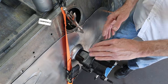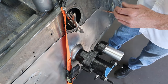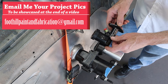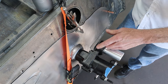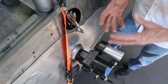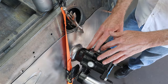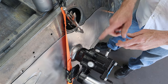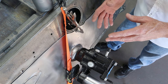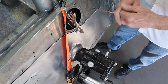I'd like to have it on this side so I have more valve cover clearance and engine clearance, but I don't think we can make it go that way. This is the compact master cylinder from Wilwood - I think it's about the smallest one they make. We won't know until we get the master cylinder installed. If we can fudge it over a little bit, great. If not, I'll have to clock the hydro boost the other way. So let's go check underneath the dash and talk about what we need to do first - we're going to have to start cutting some old brackets off, then figure out exactly where to drill the hole in the firewall.